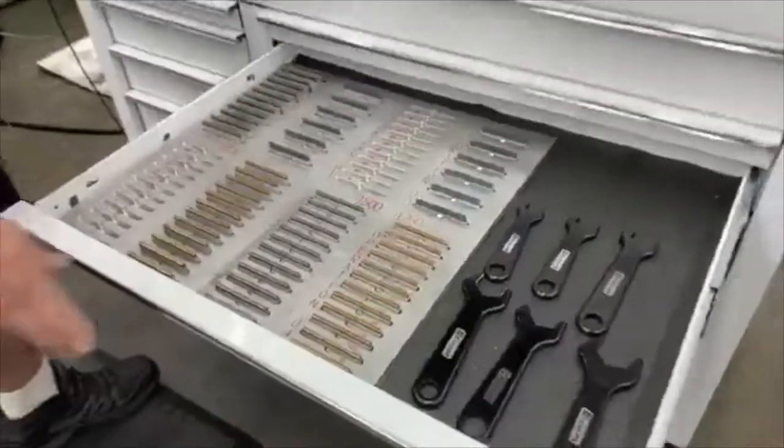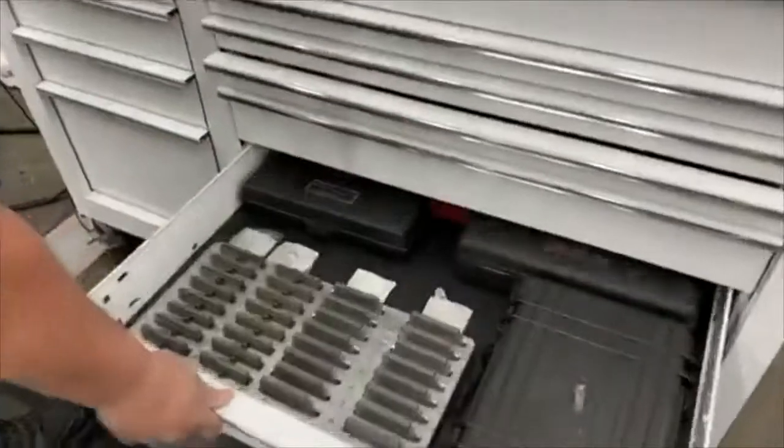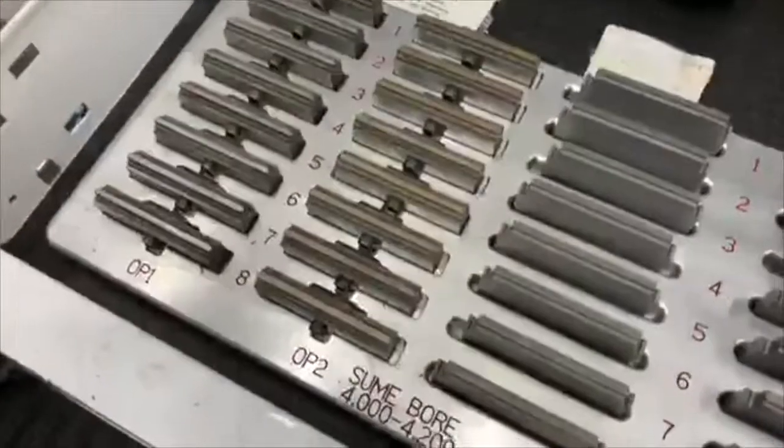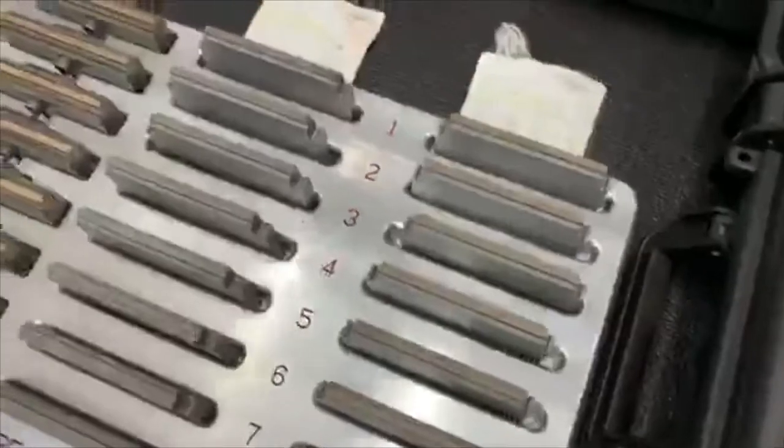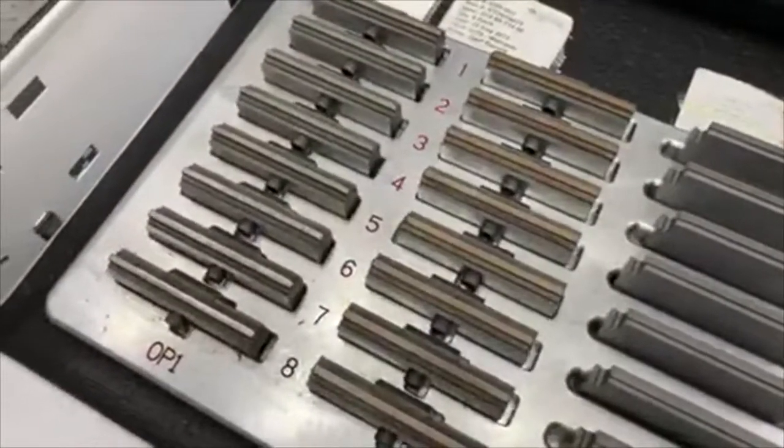What's in that bottom drawer down there, Brad? This one is for specialty stuff - actually for some sumi-bore material, similar to Nikasil, maybe a little bit harder than Nikasil. Had to do it. Had a couple of customers that were circle track racing and can't go any bigger bore - put everything to the max. But you need different abrasives to be able to hone that coated material. It's really tough to hone - it is a booger. It's a lot of learning to get it to work, different abrasives to try.